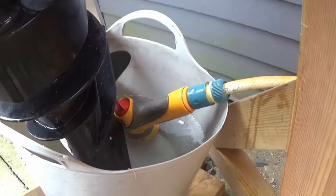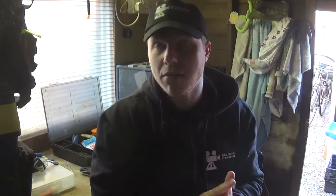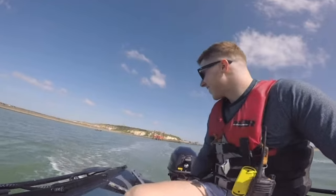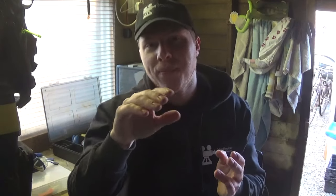What I like to use is a big bucket of water which goes over the very bottom of the propeller and all the water inlet valves and fully submerges it. Flushing an engine is usually done — pretty much always done — with fresh non-salt water. So if you've been out in the sea, when you get home with your outboard engine you need to flush it with clean fresh water. That will go all through the inlet valves of your engine and all through the little systems and it will clear out all the salt and keep your engine healthy for longer.